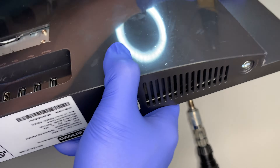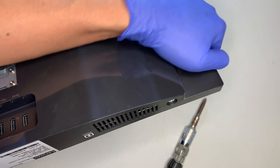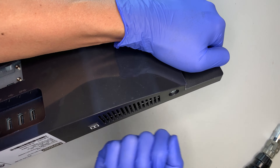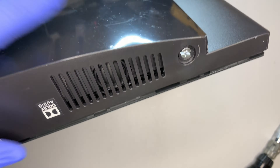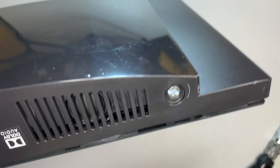Let me go ahead and turn it downward, following the arrow. What happens is that when I turn, the screen is going to be separated — this screw is actually pushing the screen to separate from the cover. As you can see, when I turn you hear a cracking noise — that is normal. The screw is pushing the plastic cover and the screen away from each other.